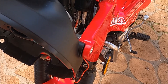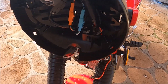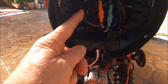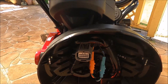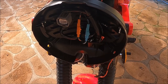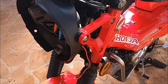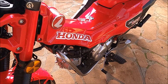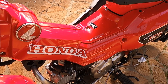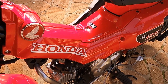It's only two wires at the back — one positive, one negative — and the positive one's in a fusible link. I was thinking to come into the headlight, and that's why I've got the headlight pulled out of the bike at the moment. I was going to hook into the power source here, but I'd have to tap into the wire and I'm not sure whether I could just put the negative on an earth somewhere or still have to go back to the battery. So I've decided I'll put the headlight back on, pull the casings off the side of the bike, and run both wires down like I did on the previous tan version — hook them up to positive and negative on the battery. That way I know it'll work and I can turn it on and off.